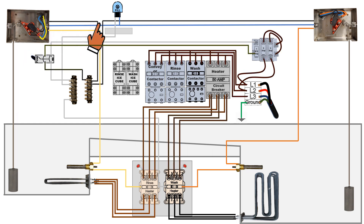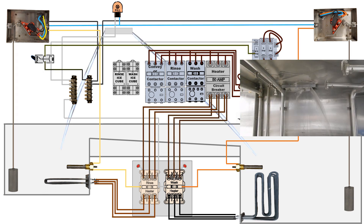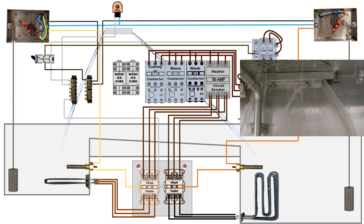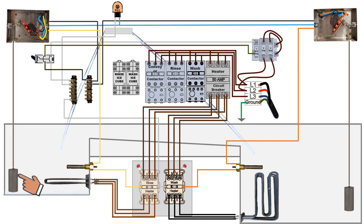As the water displacement weights relieve pressure, it releases the lever and allows the micro switch to change positions. When there's no water in the machine, power is diverted to the fill solenoid — this is when the machine knows that it needs water. Power is transferred through a blue wire to the fill solenoid. When the fill solenoid is activated, the machine starts to fill. Both tanks will be filling at the same time, but let's focus on one tank at a time, starting with the rinse side.